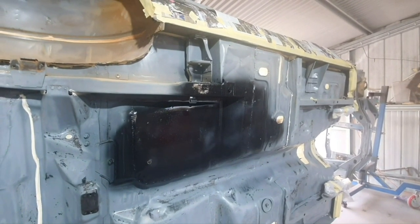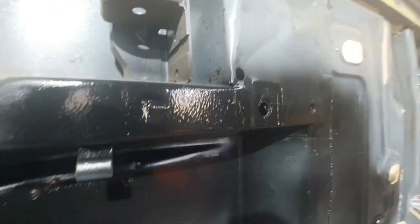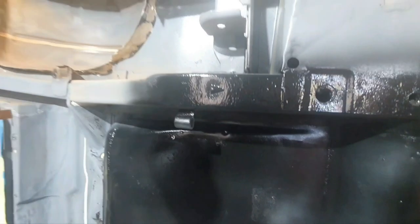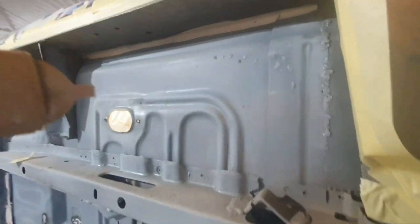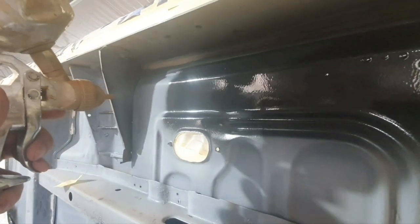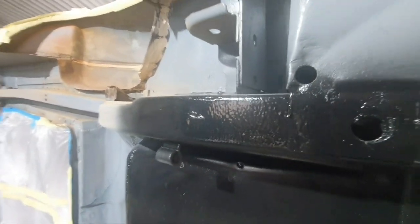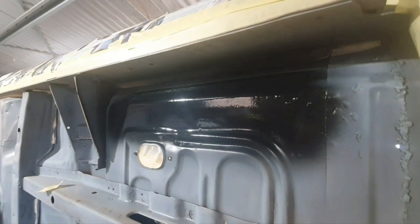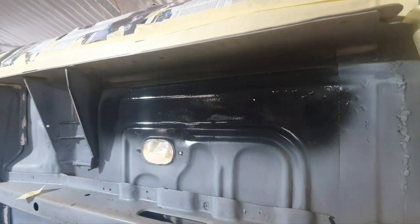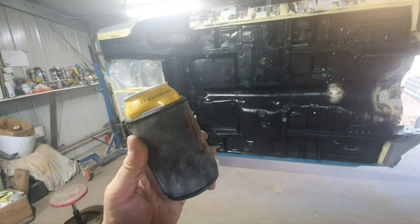I was seeing how much I could get away with not adding much thinner, but I added multi-purpose thinner — it needs the full 20%. The secret is you've got to put it on slow, you can't rush it. I've temporarily got my respirator off just to show you guys. So when I put it on — this bloody light behind me's not going to work — I'll start putting it on now. You're going to flow it on, comes out really glossy, but if you put it on slow enough you get that ripple effect. One good coat, but I reckon it's one of those situations where by the time you finish one end of the car, you're almost ready to do the other end. Temperature's good, so by a good hour from now I'll be putting the second coat on. Hopefully put three coats on.